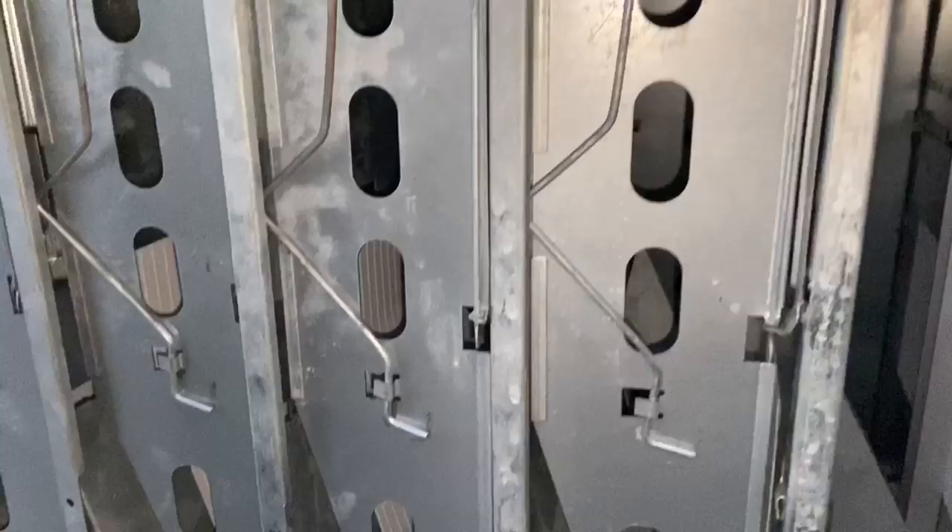Check all your motors to make sure everything is spinning. Make sure the vending machine gets cold — put your hand in the back to feel it, and tell them to have it plugged in ahead of time. Check how much debris and dirt is inside to see how well maintained the machine is. Come to the back and make sure your fan is spinning. Also check inside the back to see how dirty it is — that tells you how well maintained it is.